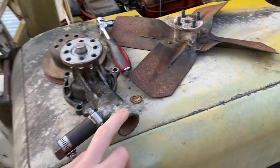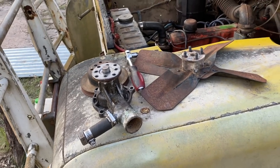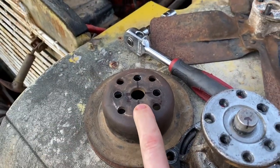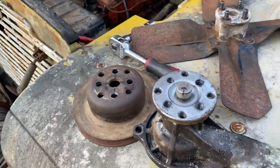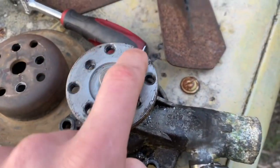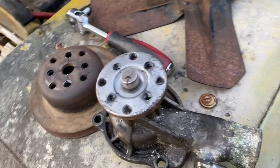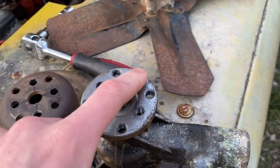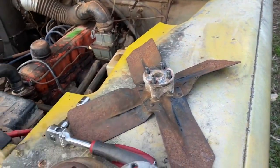I ended up finding that was the water pump. I have a later water pump off of a 202 here — a newer one. Unfortunately when I went to fit it up, the original pulley off the original engine wouldn't fit, and a second pulley off another 202 we have wouldn't fit either on the original pump because the holes were all out of whack. So I now have eight holes in both of these. The holes for the original pump would have fitted on this 179 which I believe probably came out of an EH Holden. I ended up drilling out four more holes at a new position in the water pump and drilled another four in this pulley here too, so we can bolt the original fan up without having to buy a new fan.